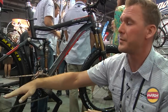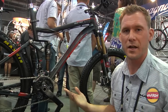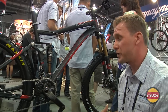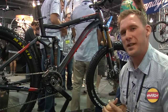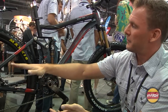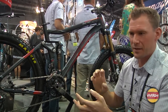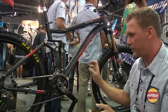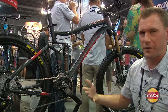As the suspension goes through its travel, it progressively gets harder and harder to compress — what's called a rising rate design. It's a nice feature if you're coming off a big jump and landing flat, whether you overshoot or come up too short — you don't want to get bucked off and fly over the bars. With the rising rate design, the suspension progressively gets stiffer and stiffer as you go through the travel. Under hard spikes, the suspension naturally tries to slow itself down. All of this is done within the suspension system itself — it's a mechanically prescribed rising rate design, really beneficial for a wide variety of riders.